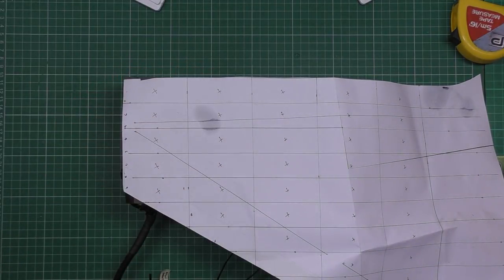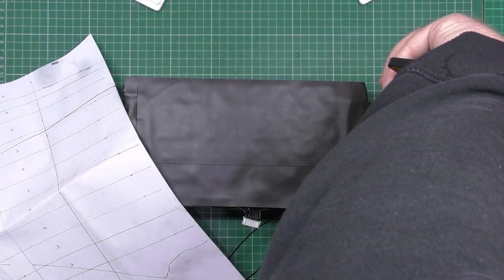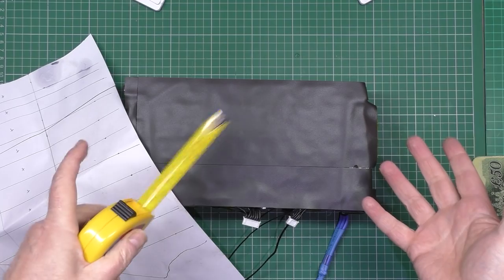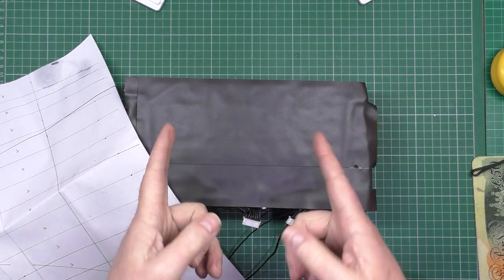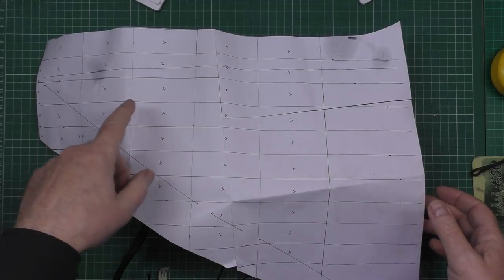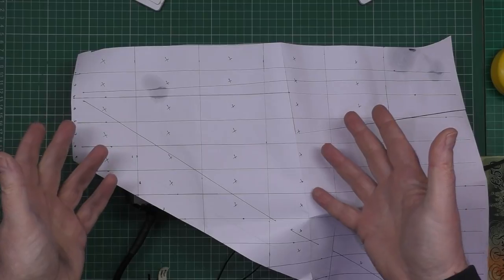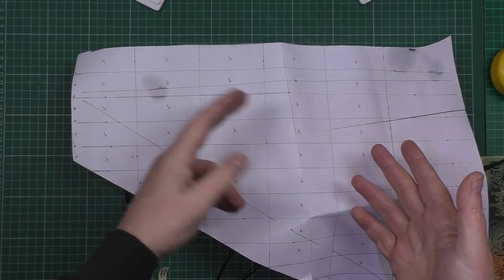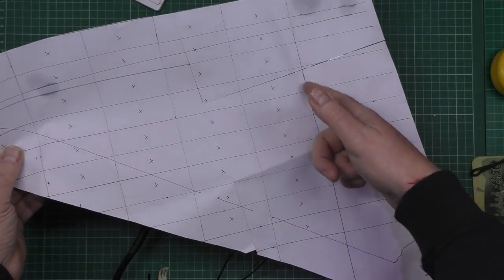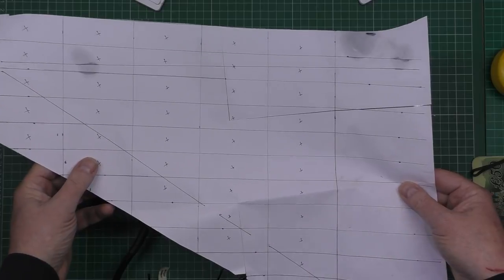Now, the original one, because they stick upright, that makes it 70mm plus the case and everything else, which makes it nearly 90mm. So I'm halving the distance outside of the crossbar. So the idea is, if I get a piece of aluminium plate the same size as that, then I can stick the cells to it, and then I've got to do some mammoth engineering and electrical wiring to get the parallel series connections in line. It's not going to be easy, but that's the layout, and then they'll come to about here. Yeah, that's in theory. That's if I've drawn this right. If I haven't, I ain't going to be very happy.